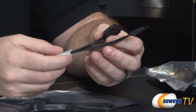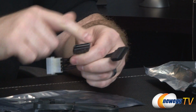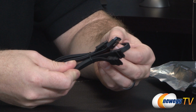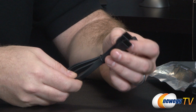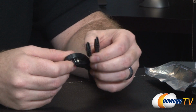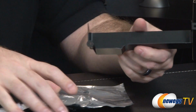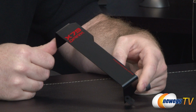All right, another adapter here. Wow, they're really making sure you've got plenty of serial ATA connectivity here. So again, Molex to a couple of serial ATA plugs, so it'll break out right there. A couple more serial ATA data cables right there. Again, both straight plugs on both ends. These are the flat cables, but they are all black once again. No clips on this one, but don't worry. These will work with your fast SATA Rev 3 SSDs, so those will be SATA 1.5 gigabits, 3 gigabits, and 6 gigabits per second capable. I think that's the first time I've ever described those SATA connections like that.